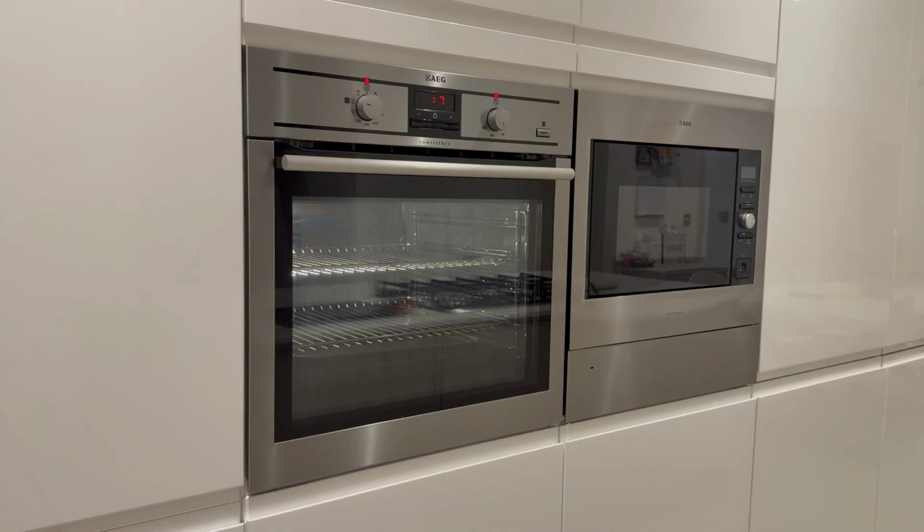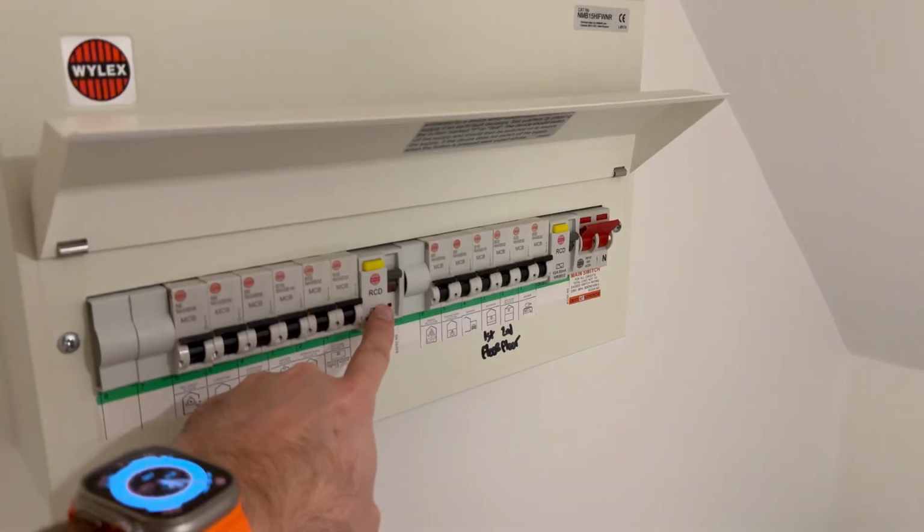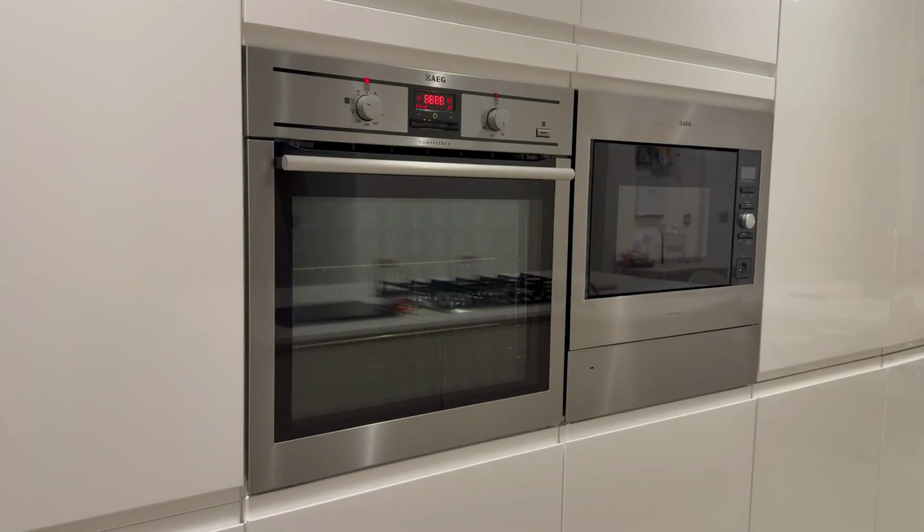The most likely cause for this is the outer sheath on the heater element has developed a crack or pinhole in the insulation, then moisture is getting in and causing it to ground. Once I flip the RCD back on, the oven comes back on, but will not resume heating until the clock is reset.